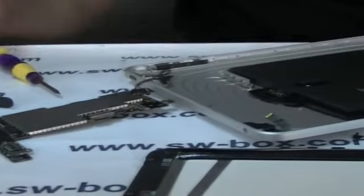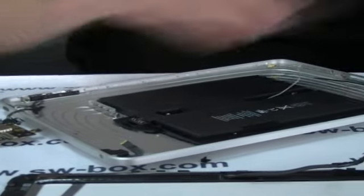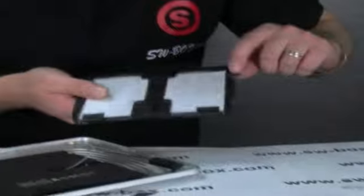In many ways it's like a PC chassis where if you're going to remove the CPU, you would release the latch as well. It's not difficult. The motherboard itself is held on by two screws — I'll just take this one out over there and wind that out. They're all small T3 screws. And there's another one just here. The motherboard is free. I'm going to lay that back there and move it out of the way. All you've got to do now is with this tray — it's stuffed down on the outside, there are no more bolts, everything is screwed in from this face.